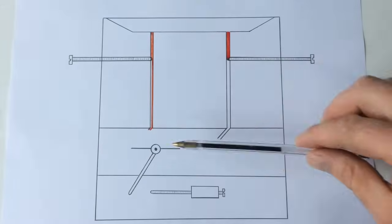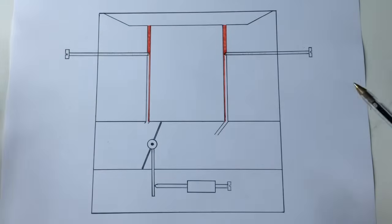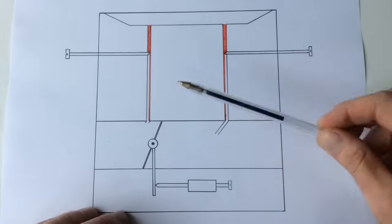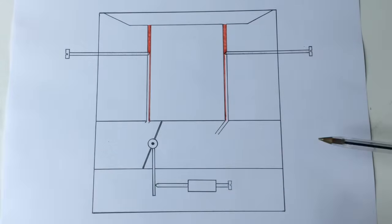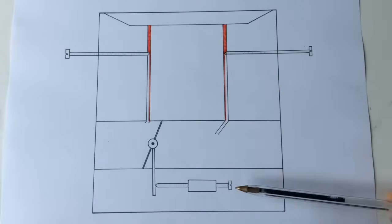And if we were to keep screwing the high screw in until it stops and blocks the fuel off completely, with the full throttle on we haven't got an efficient amount of fuel to go into the venturi in order to go into the engine - it's just going to stop and nothing's going to come through.